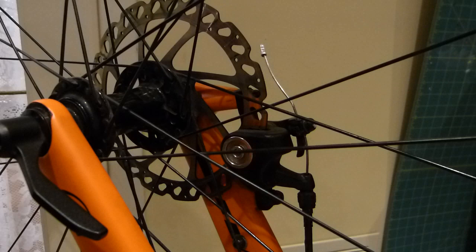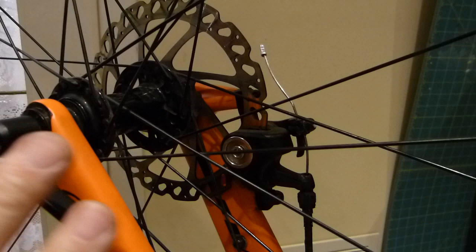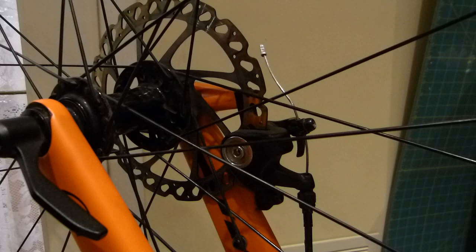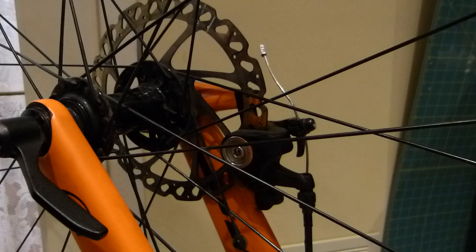So, the first thing that I do is I wash everything, and it takes me about half an hour. Everything is dried as well. So the hubs, the spokes, the brake disc, aka rotor, the caliper, the brake pads themselves, the old ones, for clarity, have been washed. So this is not how you find them normally. You find them covered in muck or at least brake dust, thickly. This brake dust masks any deficiencies in the brake disc and will interfere with some of your bolts and will interfere with the fit of putting the new components in. So everything, in my opinion, needs to be super clean.